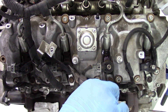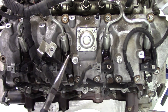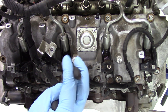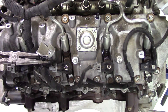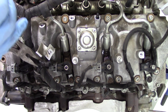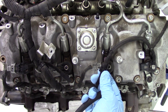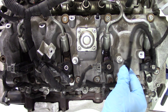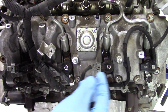I'll demonstrate on cylinder number four: grab right in the middle of the T and pull straight up. If you do that, you won't wobble it side to side, which causes it to break in half or leave plastic down in the cylinder. Pull the clip, grab right in the middle of the line, and pull straight up — as you can see, no damage. If you don't do it this way, you'll end up with a broken tube and will usually have to replace the entire line.